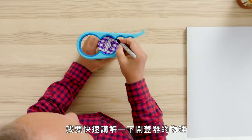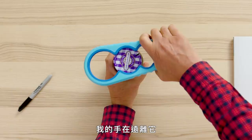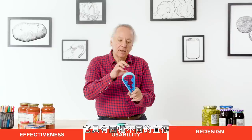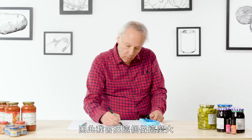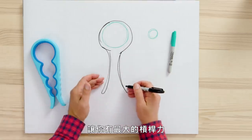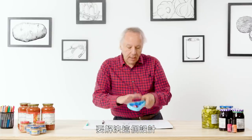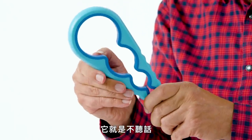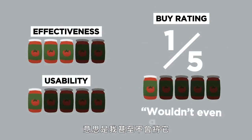I'm going to give a quick review of jar-opening physics. Watch that mark and watch my hand — my hand is moving further because it's in a bigger diameter than the jar. The longer the handle, the more mechanical advantage you have. This is a tough one because there are some inherent flaws in this design — it gives you four separate diameters and two of them are less advantageous in terms of providing leverage. I think I would make one big one for maximum leverage and a separate one for small jars. The rubber needs to be something with a lot more friction — it's just too slippery and not grabbing the way you'd hope. My buy rating for this is one — meaning I wouldn't even give it away to someone I didn't like.